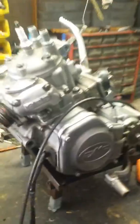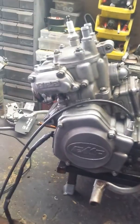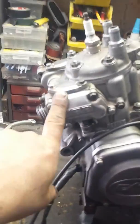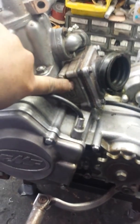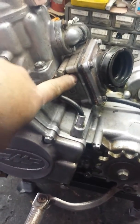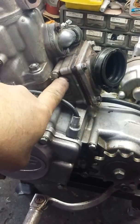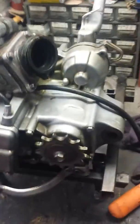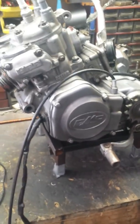This is the most sought-after engine right here — a 1999 CR 125 — and this is what everyone races with. It's not quite set up yet. I still have to pull the valves and put a tap hole into the reed box here for the nipple to feed the pulsating fuel pump. By the time I'm done, this will be race legal.